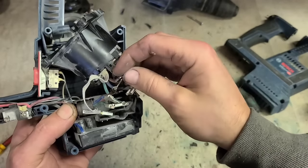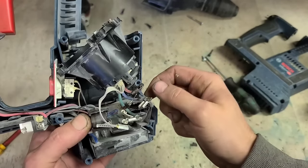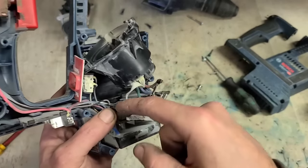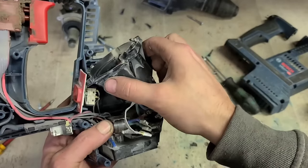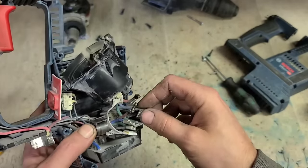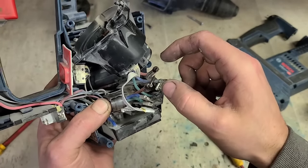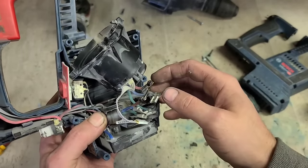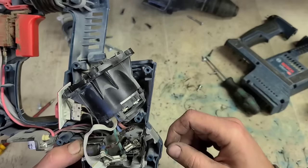But one of the cables is burnt, so the resistance on that cable is going to be a little bit higher. But then the resistance on this lead here, coming from the controller, is also going to be a little bit higher. So replacing the stator is not going to give us much advantage. The only thing we can do is reconnect this as best as we can, so that it gives better contact and there's less resistance going through it, less chance of it burning up again. So keep this, we'll fix this connector.